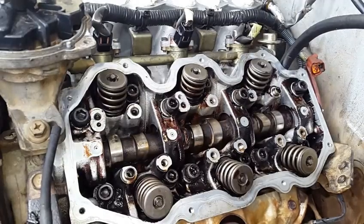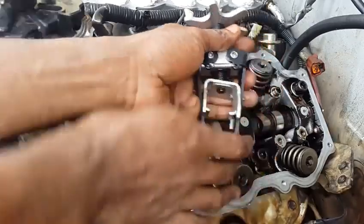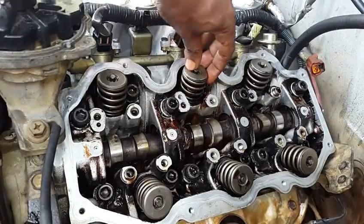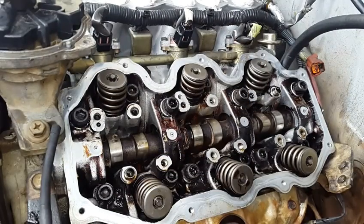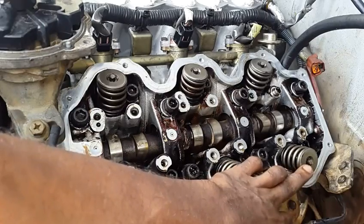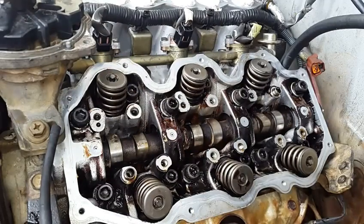We are back at cylinder number six exhaust valve. This tool has basically reached its limit in helping us replace the valve stem seal on this side, but it will still be good to use for the right side. The customer is coming for this vehicle and we've got to get this vehicle done today — we want to get it out of the shop and we want to get paid. We can't wait for another tool or take off this brake booster, so we have to fabricate something to get this valve stem seal in place.